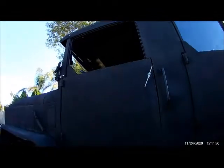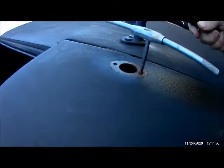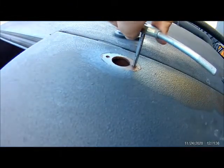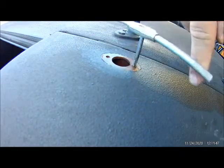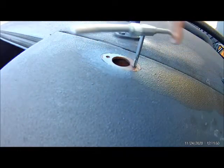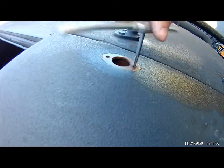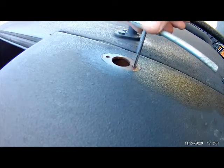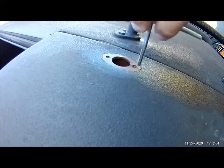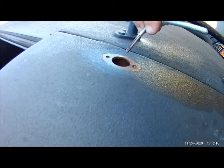I changed the battery and decided to tap it. This is a normal tap — it's going slowly. It doesn't look like it was re-drilled and welded; it may have just been a little bit off when they made the door. This is a 10/32 tap and I'm going to see how good the threads are. There may not be enough bite and I may still be forced to drill and put a nut insert in there. Yeah, they're not very deep.